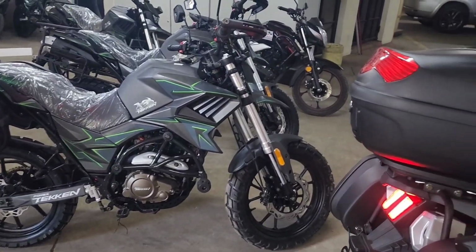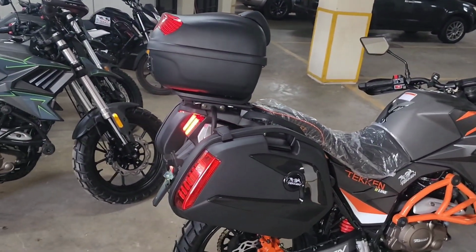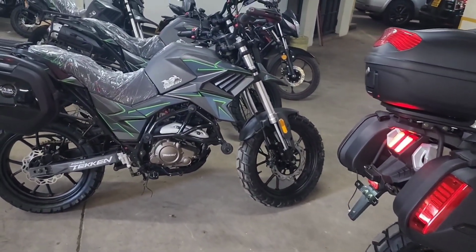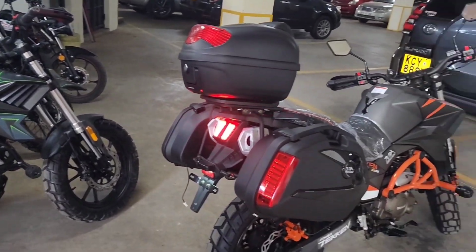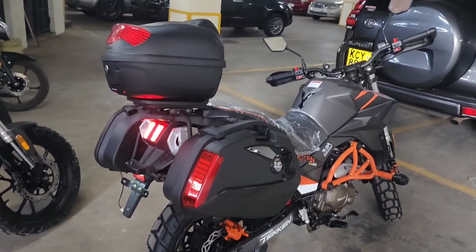You find some clients saying, oh, my Tekken gives me a maximum of 130 kph, while my friend's Tekken is going 150 kph. Ask your friend how he broke in the engine. This guy wasn't going over 100 kph or high RPMs during the first 1000 kilometers. It's like a young child.